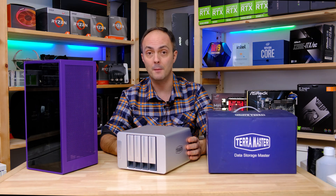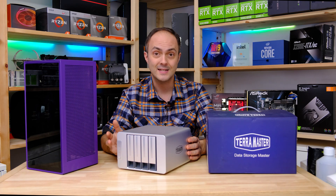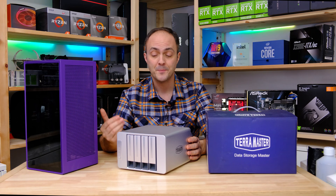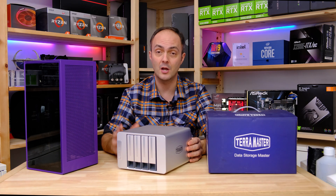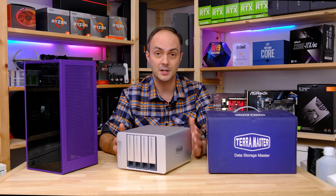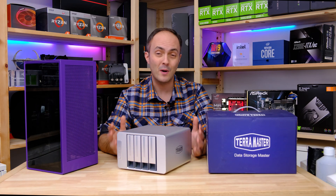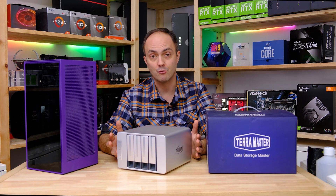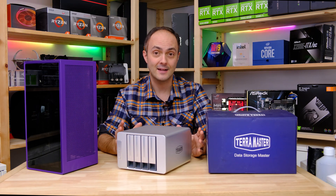SSDs are great but Mini ITX motherboards only have two, three, or four SATA ports maybe, and one or two M.2 ports, so you can't often connect that many devices to them. Also in cases like this you simply cannot house that many hard disks — maybe one or two at most. So when it comes to providing space for more than two hard disks in a big storage array to house terabytes and terabytes of data, they can come up short.